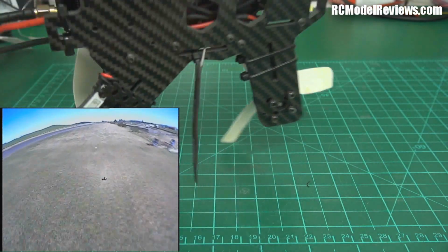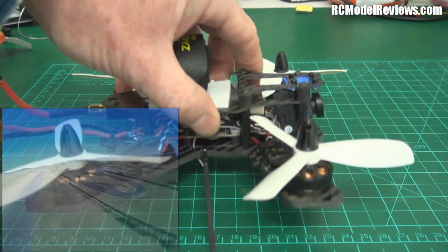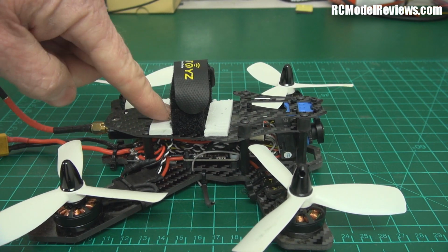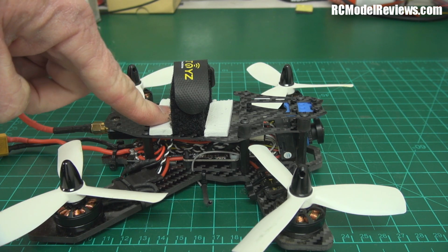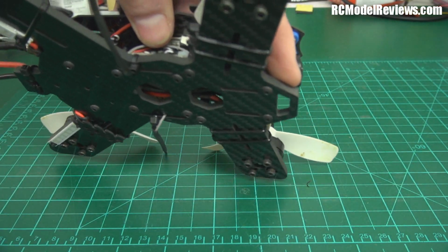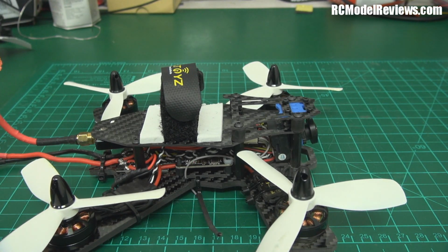And these are plastic standoffs, which I'm actually divided on whether plastic standoffs are good. They do tend to flex a little bit and absorb a bit of shock and impact rather than permanently bending like metal ones do, but by the same token they're simply not as strong and the screws can pull out, they can strip out much more easily in here, but so far I haven't had any problems with it, so I'm happy with those. They seem to work pretty damn well.